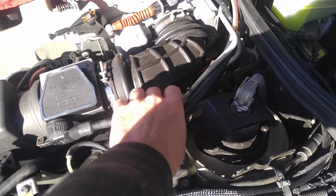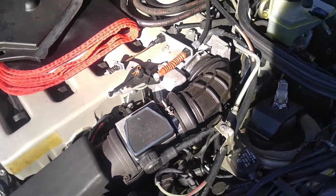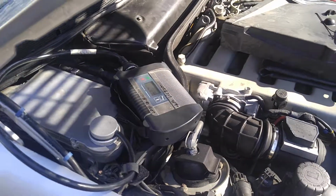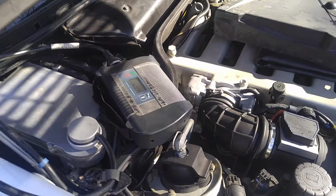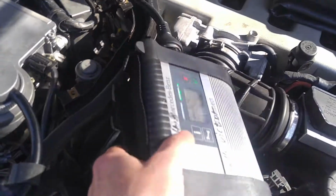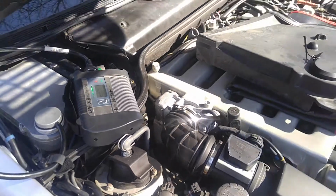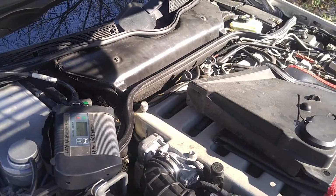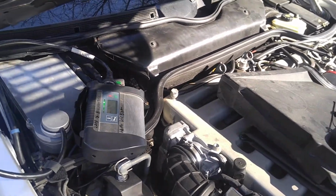So what I'm gonna do next is, I actually had it done yesterday, so I was doing it for 2 days. Yesterday I finished it, but I couldn't start the car because I wanted the silicone to set, and also I wanted to seal this valve right there. This one right over there is a vacuum distribution valve, kind of like a manifold. They always leak, so there was a crack on the bottom, so I siliconed it. I wanted to wait until the silicone dries. It is dry now, and this is going to be our first start.